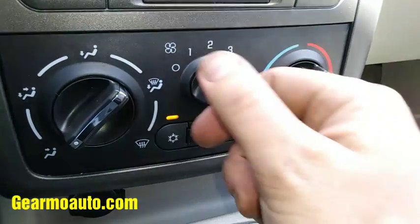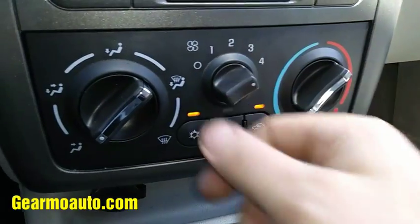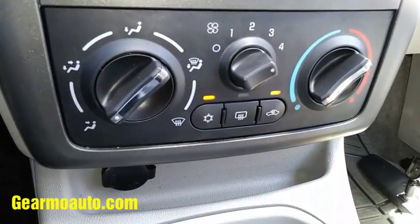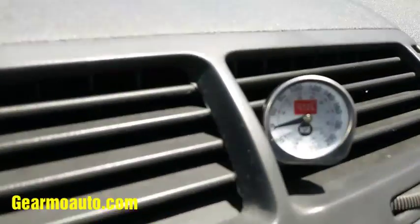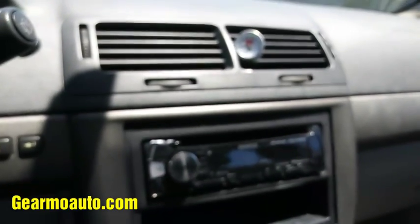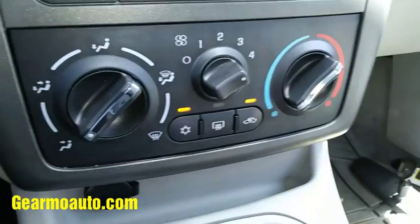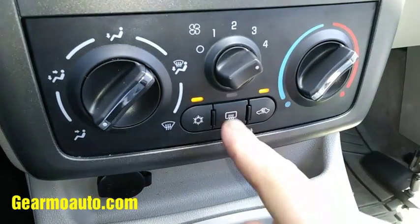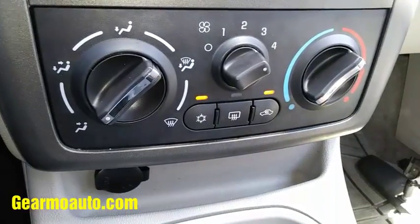Hopefully this video helped you out and your AC is working normally. If you're getting no cold air at all and these buttons are lighting up, you may be low on refrigerant — or they may not be lighting up at all, meaning your compressor isn't turning on because of low refrigerant. Coming out the vent, you should be getting around 40 degrees on a warm day. Any additional information or questions, put them in the comments. Thanks for watching — see you next video.